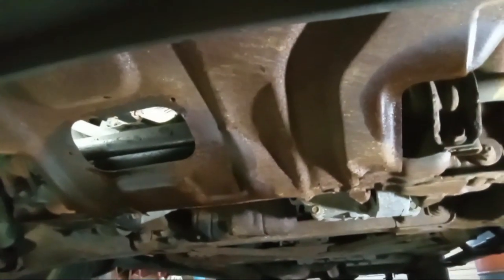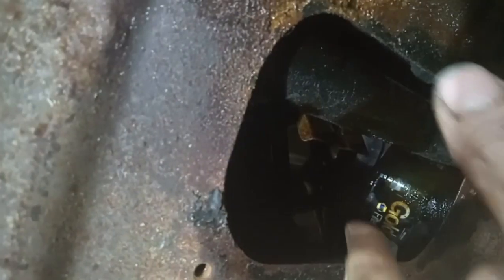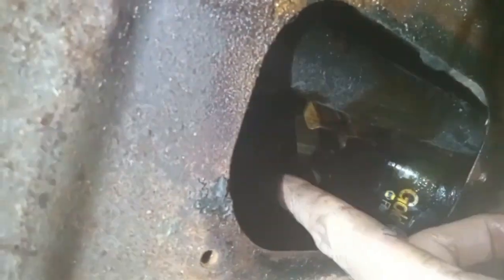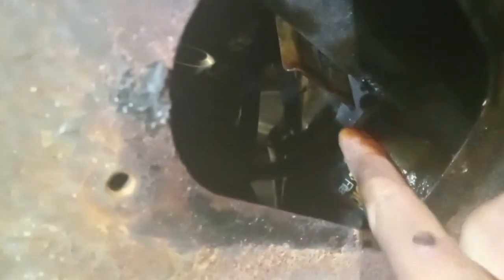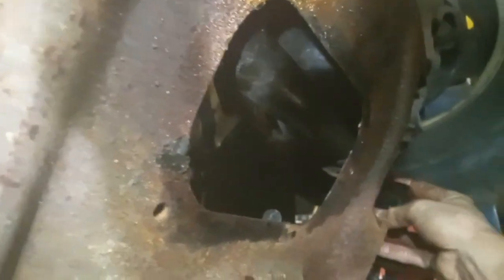I went ahead and was able to get it loose by hand. The filter does not fit through the access hole — if you think you're gonna drop it down and pull it through, it won't fit. There's a little metal plate here and the oil is actually gonna run off that plate into your oil pan. So loosen your filter, let it pour out onto this plate into the pan, and then feed the filter out the side of the skid plate — just reach up to the side of the plate there and pull it down through, just like that.